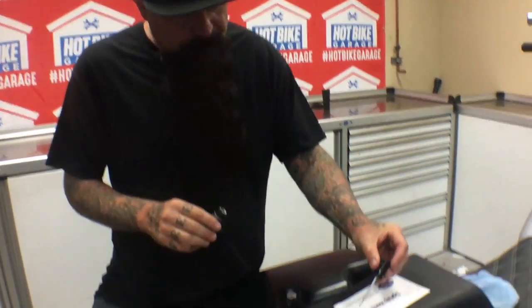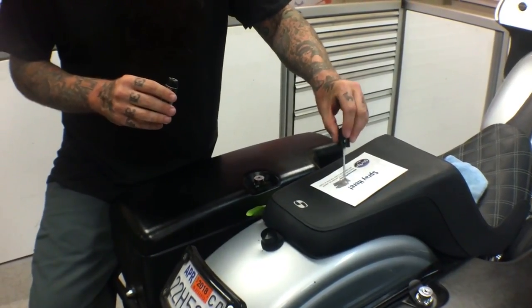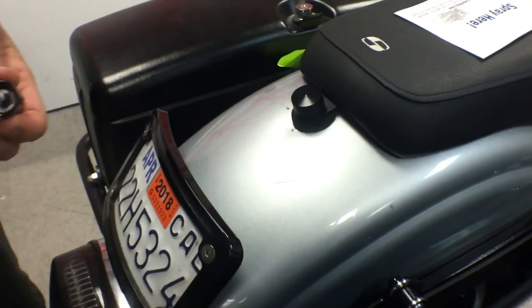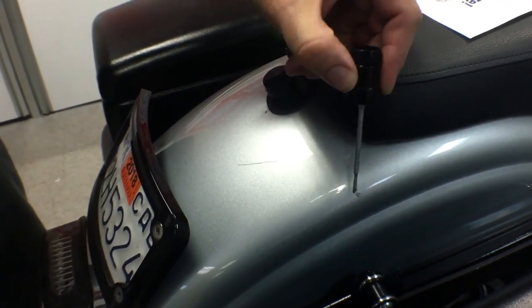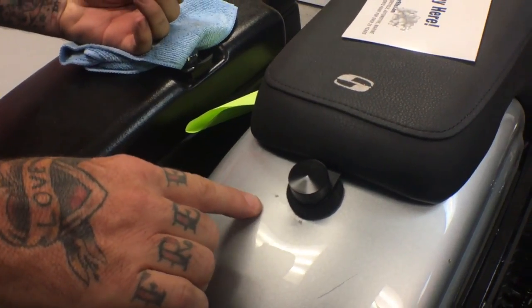What we're going to do is take a little dab, put it out here, get the brush with a little bit less paint on it, and just dab it right here. Dab a tiny bit more, and I'm going to wait — because under the rules of ColorRite you don't want to put a bunch of paint on there, as putting too much paint before clearing it leaves it darker. You just want to put enough paint to fill it and it'll color match perfectly. Here's a spot we didn't do any prep to and I'm still going to put some paint on it to see what happens.